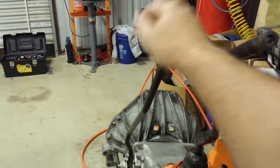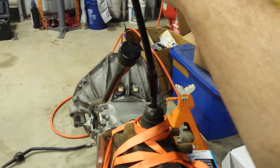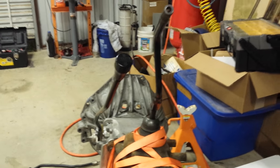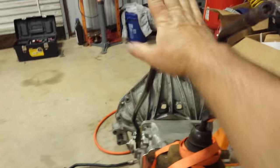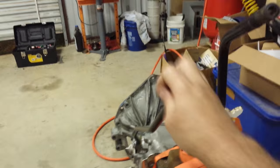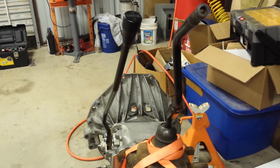Here's how it works: you start in direct drive with your regular granny four-speed. If you don't know about a granny four-speed — first gear is compound low, so low that for normal daily driving with an empty pickup you start in second, shift to third, then fourth. Now with this overdrive unit, once I'm in fourth gear and up to freeway speed and want overdrive, I push the clutch and move that lever forward — now I'm in fourth-gear overdrive. So I'd drive it second, third, fourth, overdrive.